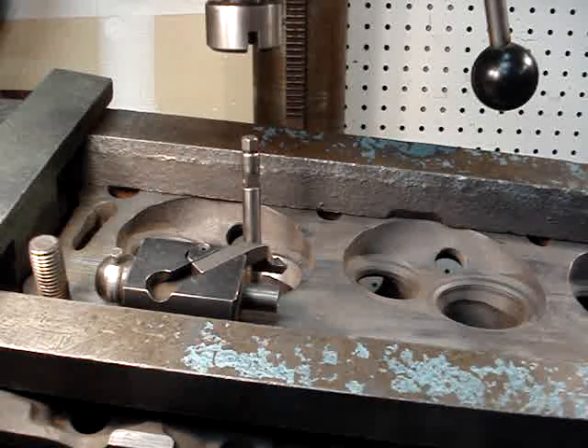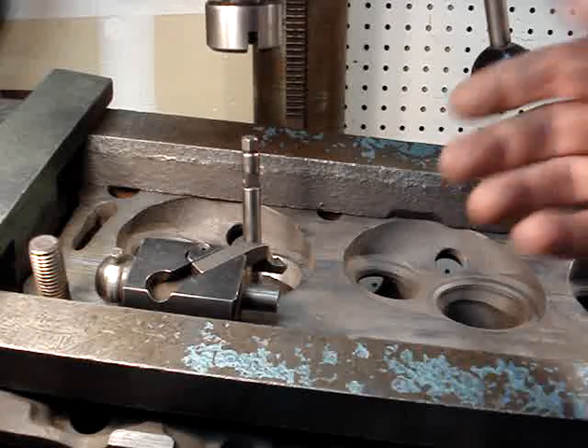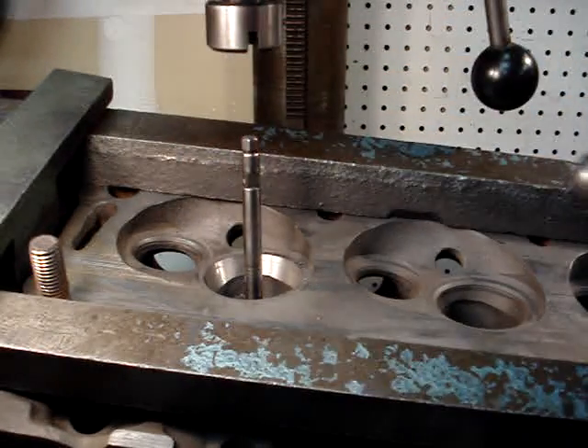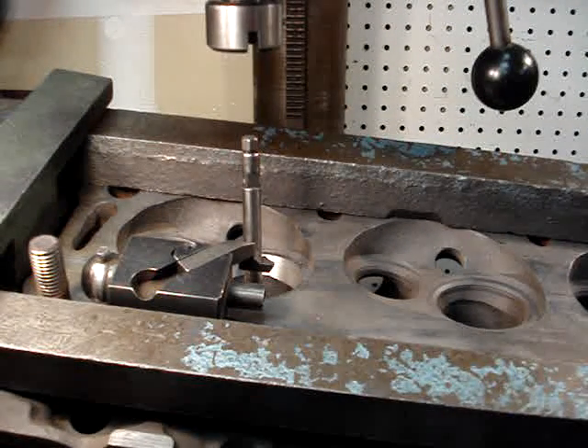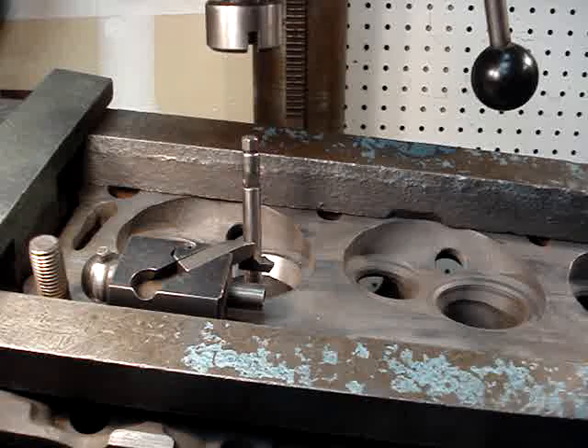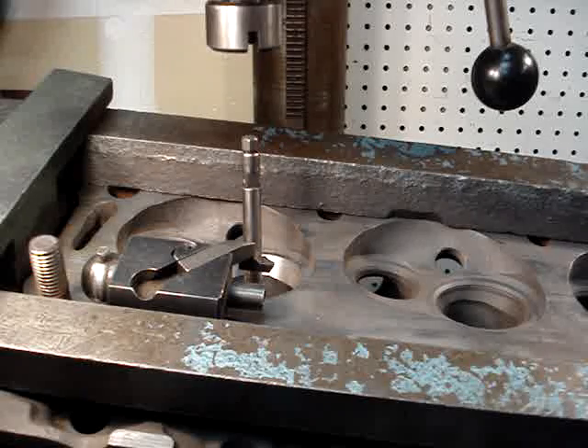So today, we've got a 460 head set up here on the machine. This is another situation where we're taking a stroker — a stroked 460, which is going to be over 500 cubic inches. And we've chosen to go with some early dove heads on it. And later on, the customers may get some aluminum Ford Motorsports or something of that nature. But for now, we're going to go with the factory head, do a little porting on them.